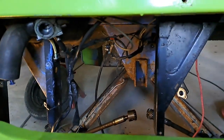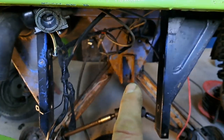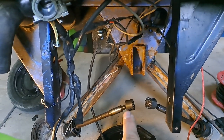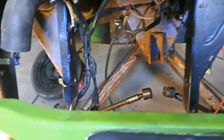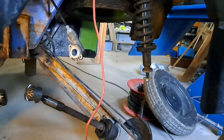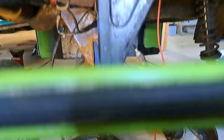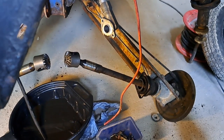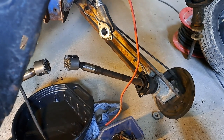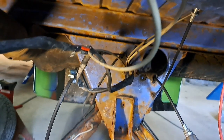You see in here is a hole. We have the engine mount in the back and we have the engine mount here. These two drive shafts — drive axles — coming out from the differential. To get them out, I took off the shock absorbers on both ends and made the entire arm so loose that I could actually ease out the drive shafts.